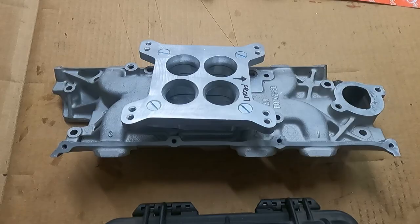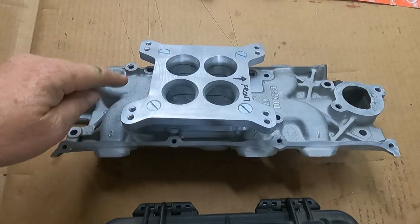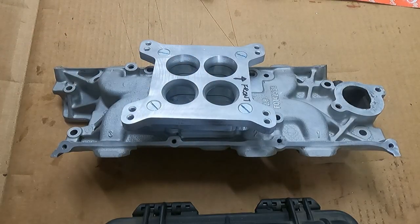All right, we're back here at Moment Machine, and we got this 2800 4-barrel manifold wrapping up. So we finally got our spacer in today, the one we were waiting for. And this is the last piece that it takes to get from the WCFB teapot flange up to the 4150, 4160 that we're going to use with either 390 or 465 or something like that.